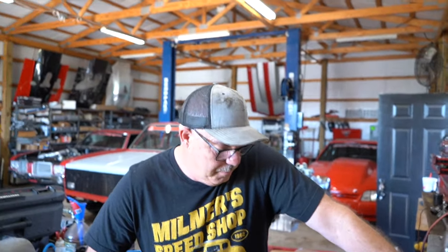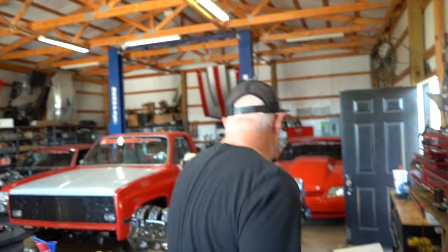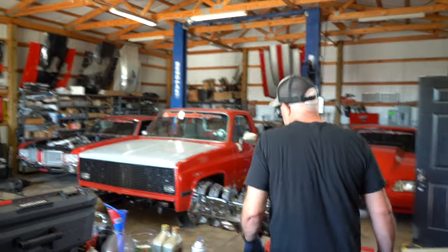But yours actually, the piece that was welded to this broke off and just fell off in there. You still raced it. Still won the final. I was on the cruise in the Yeti in Kansas City and had eight pounds of oil pressure. And then it'd get oil pressure when I was making a pass because all the oil would run to the back and it would pick it up. But when you let off, it would go to zero because it would all rush forward. We took that thing all apart and it didn't even have a bearing mark on it. I won the class and brought it home and we took it apart the next day and it was fine.